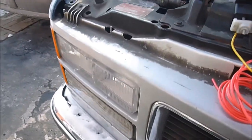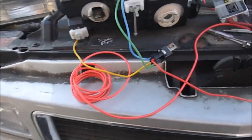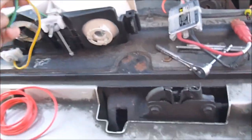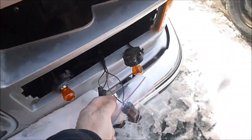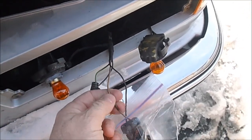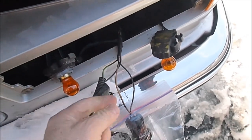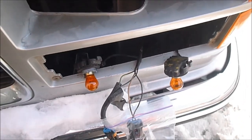So modifications that can be made — that you see on a lot of forums — are modifying it so that the low beams will stay on with the high beams. There are good ways and not so good ways of doing it. Just hacking in a couple of wires really won't cut it, so it's always good to use relays and circuit breakers to protect your circuits. Try not to cut the wire harness totally, but rather just slip the insulation back a little bit, wrap, and then solder your added wires on from your relay onto the new setup.